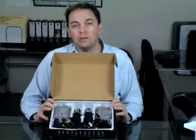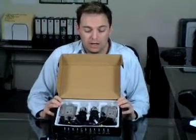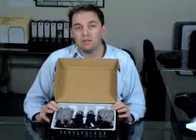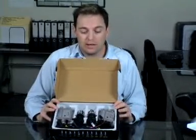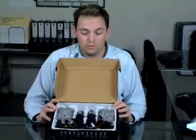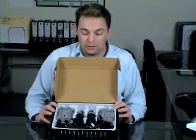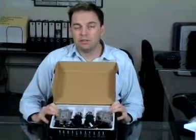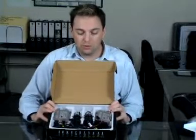I was actually talking to an auto electrician in Queensland only maybe 6-7 weeks ago, and they were telling us about how they fitted a HID kit to a 300 Chrysler, and after about an hour of trying to troubleshoot, they actually had blown one of the computers on there and had to go back to Chrysler on a train and get that fixed. So if your car is running CAN bus, you definitely need a CAN bus electrical system, which will eliminate all those problems.